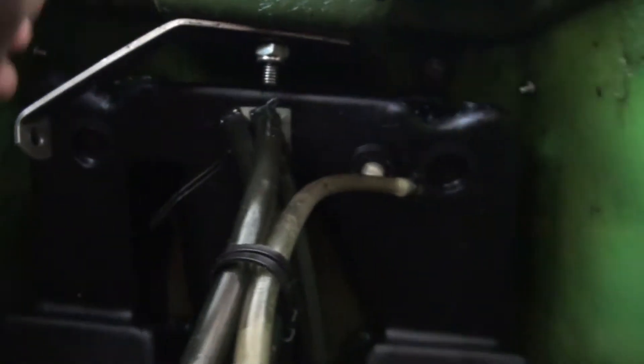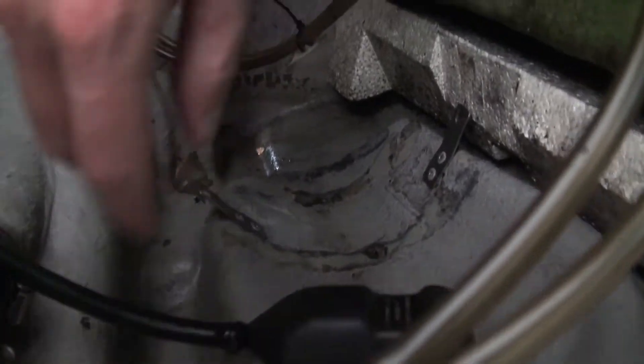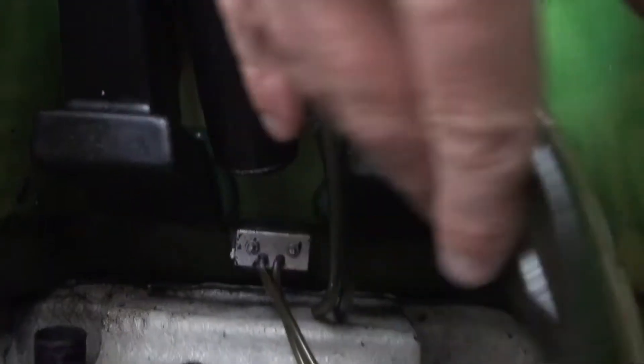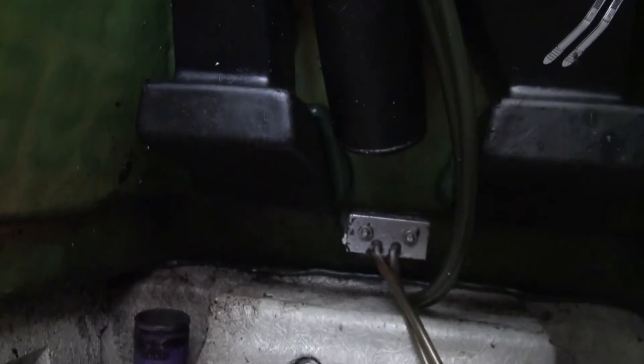So you can see that if and when water does enter, it has to go to the highest point here to actually physically enter the hull. And if any water does enter the hull, it's going to come down and immediately get picked up by these baler pumps, which are powered by the jet pump, and exit the ski. They're constantly using the forces of gravity to separate the air and the water, so it's pretty difficult for water to make its way up those air dams.